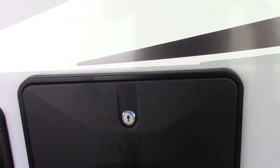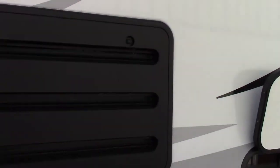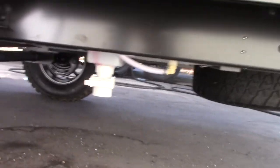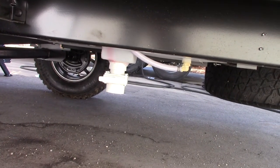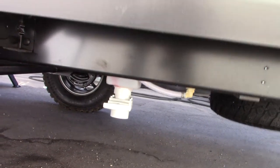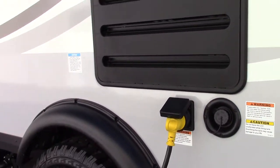This is just an outside shower — hot and cold water. These are service panels for your refrigerator. That white valve down there is the dump valve for your fresh water tank, so if you don't use all the water in your fresh tank, you can dump it before you leave. This is your shore cord, your power cord — both terms are used. It's 30 feet long and 30 amps. It has to be a 30-amp system because you have an air conditioner.